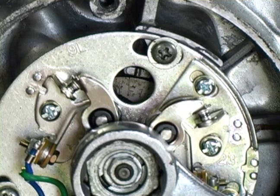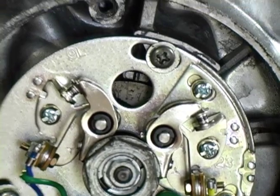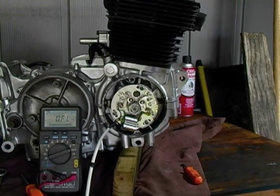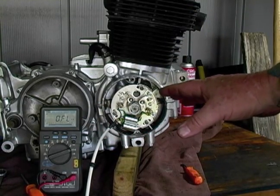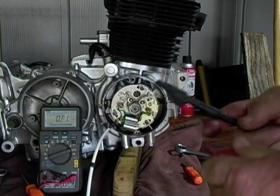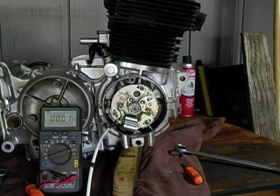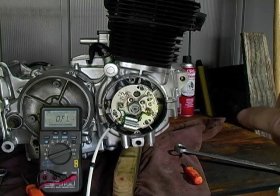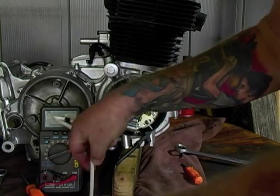Now I'm going to keep it just short of the mark at this point, because here's the process. I'm going to be using an ohmmeter to let me know when those points have opened. Right until I get to that F, I want to see that change from closed to open. So I'm going to be looking for that as I slowly bring it up to F. I'll access that by putting one of these meter leads on the ground and then one on the corresponding points wire.